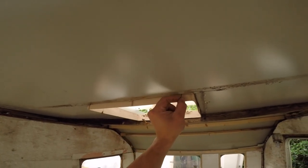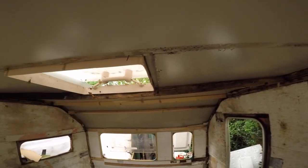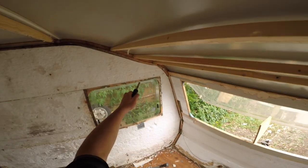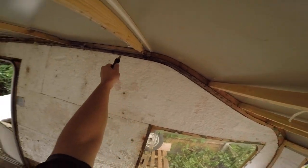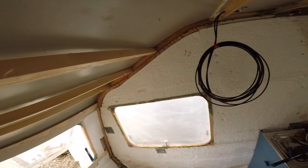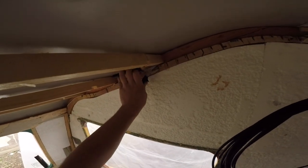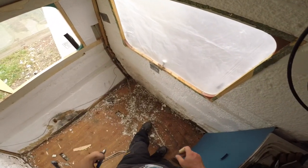Everything is done from the outside in, so I'll need to remove these without breaking them, clean the silicone from up there and put new silicone in. Removing all these things - I think I'll keep this side until here and that side until halfway. It's stuck to the aluminum - I'll probably have to replace that bit. Take out these rivets, these staples one by one and clean the place up.